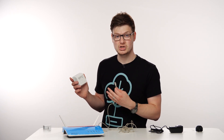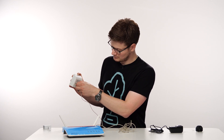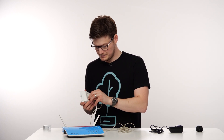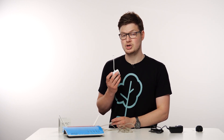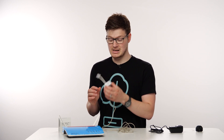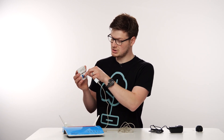Now this is only for DSL because it's broadband or FTTC — you wouldn't do this for FTTP, that would be a different setup. Then with the small side of your DSL cable, go to your filtered faceplate on your socket and plug it into the smaller side of the socket. You may have a different style socket or a different filter — if you're unsure I'll go through it in another video where I talk about all different types of sockets. If you find that your router doesn't have a filtered faceplate, what you may need is a microfilter. You should have this from your previous broadband service — you can still use the same one. Simply connect the smaller end into the filter and then that will slot into your socket.